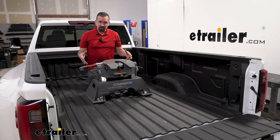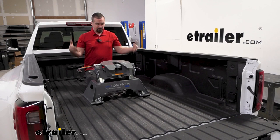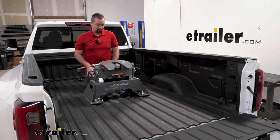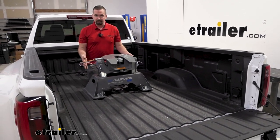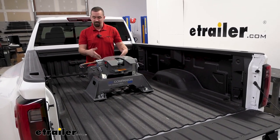It's really nice with factory puck systems already on trucks — they know you're going to be using a fifth wheel and B&W has designed this to work directly with that Chevy style puck system. So it really is just a drop in and go, which is great. Not only for installation purposes, you won't have to get rails, it keeps everything nice and clean when you don't have it in here.